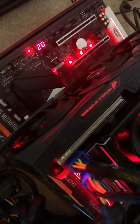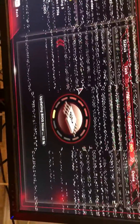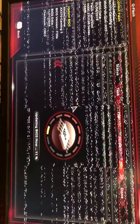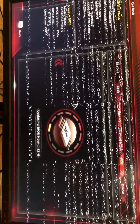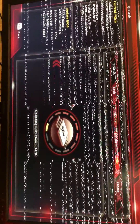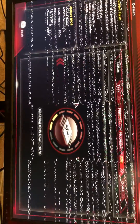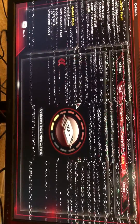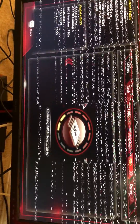Holy crap, I got it to boot — we're flashing! You can see the screen's totally garbled but it's booting. My solution was to pull out the NVMe stick, so maybe somehow the NVMe portion of the firmware got corrupted. It's interesting because the last time it booted it wouldn't get this garbled screen but it would fully lock up. Now that I've switched processors a few times, the screen's all garbled, but hey — it's booting, and that is way more than I had before.